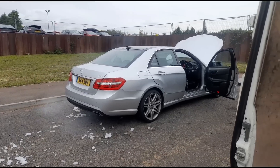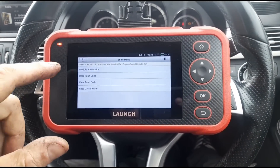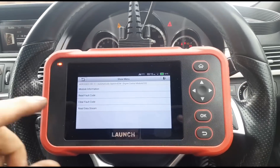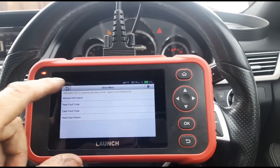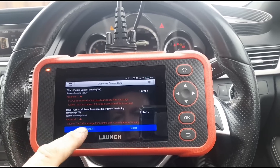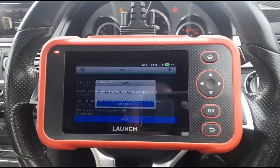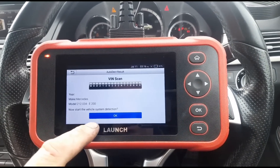We'll let that run for a few minutes until the vapor fades away. Now I need to tell the car it's had a new DPF, because the pressure is down to where it would be with a new DPF. First I'm going to clear the fault codes. The soot level code didn't clear because we need to tell it there's a new DPF — let's find that option.